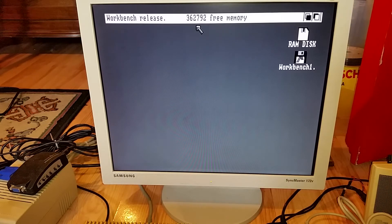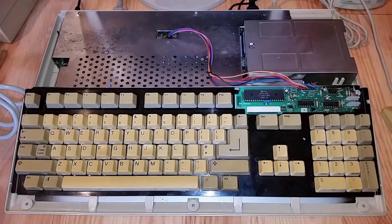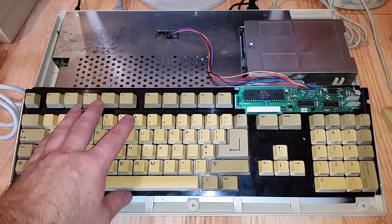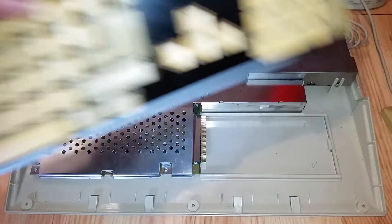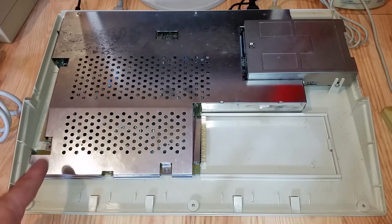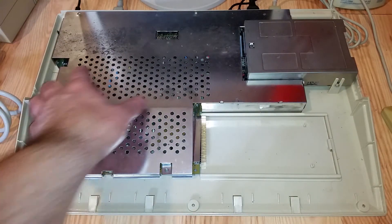After installing the chips that should go up by about 500K, so I'm expecting about 862K after the memory is installed. I've already taken the screws out of the bottom of the case so the top just lifts off. I can pull that to one side, and the keyboard just rests here - you pull out the connector and lift the keyboard off. I've taken out the four screws holding the RF shield and bent the tags upwards, so it should lift out reasonably easily.